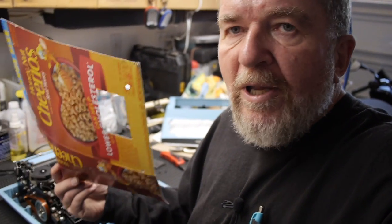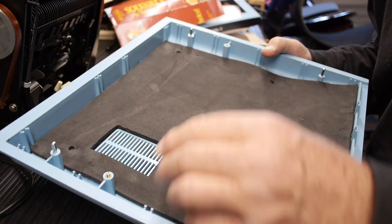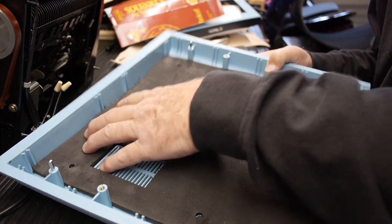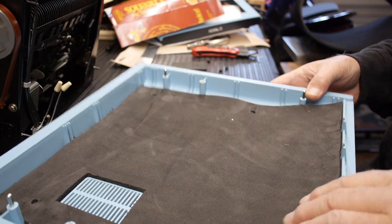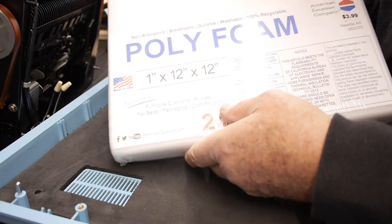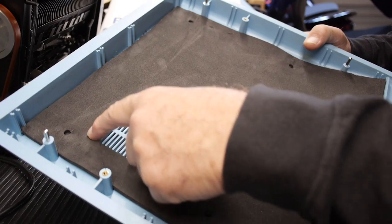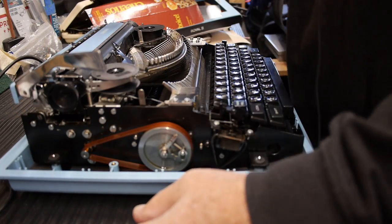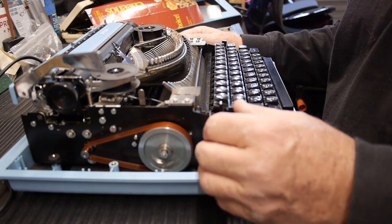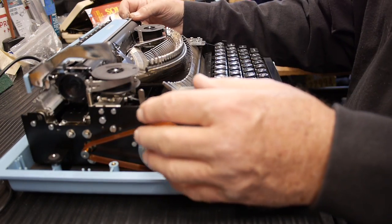For the bottom sound insulation underneath the chassis, I've cut out a cereal box cardboard template and I'm using quarter-inch thick dense craft foam as the sound insulation. Here is the cut insulation seated in the base. There is a gap along the sidewalls, so I'm going to fill that in with some one-inch thick polyurethane foam — cutting some blocks to add to those little spaces. I've also given room for the vent, and it seats down on those posts. Everything tests and works just fine.